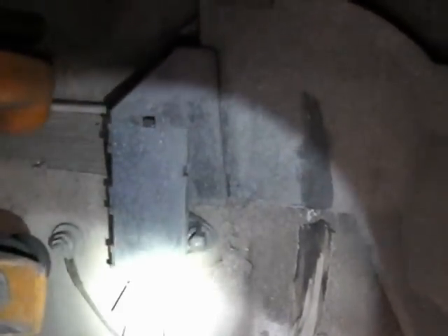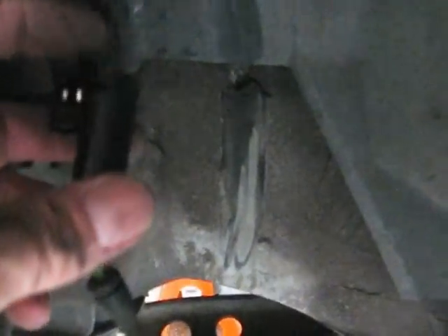There's a cover where the brake wear sensor connects, and on this '95 it's got little tabs to open it up. Be careful you don't break these off, otherwise you'll have to buy a new one or glue it. We'll disconnect the old sensor and put the new one in. Be careful not to damage the male end of the connector because that runs into the wiring harness — you don't want to have to replace that.